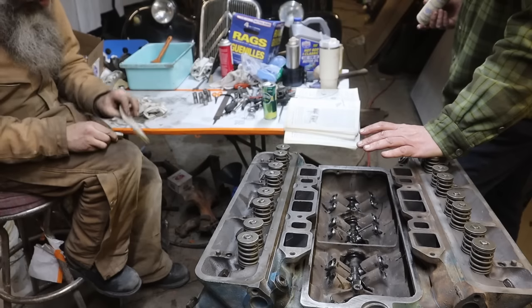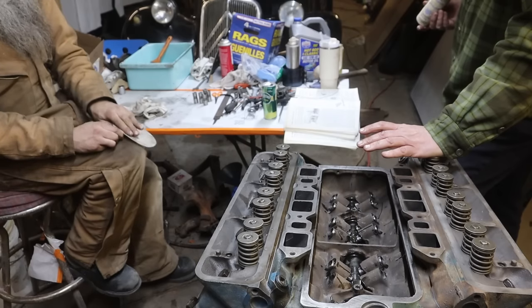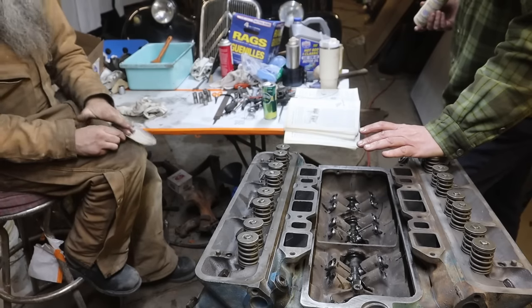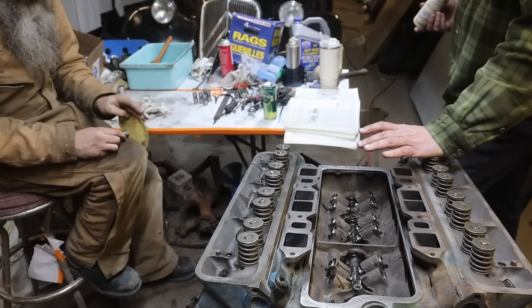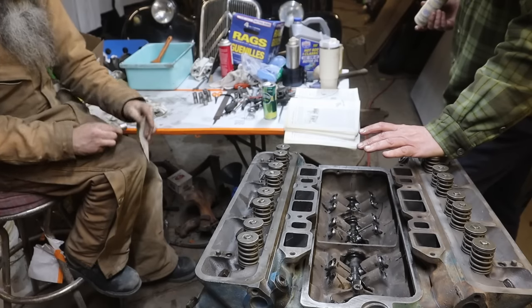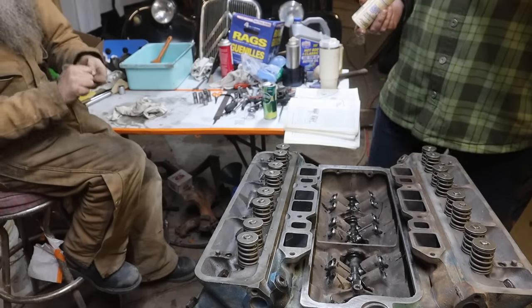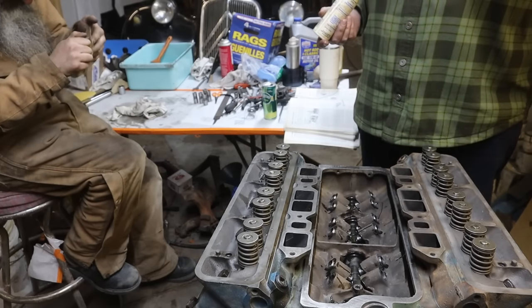No, I mean, as long as there's no burr, the dent itself is harmless. It's the burr around it that'll wreck it, right? So if we can get the burr off, the dent doesn't matter. No, it'll just trap oil. Yeah, that's fine. That's what this groove is for. It's just a second oil groove at this point. Yeah. But, guys,